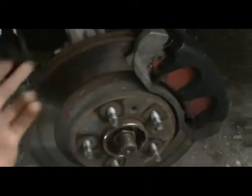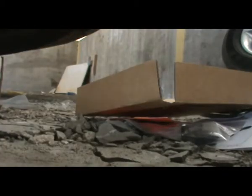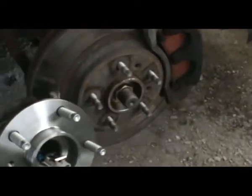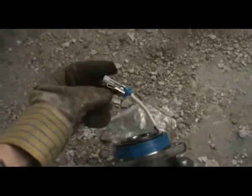Once we remove the disc, those studs where the wheel hooks up — that's the actual hub, the bearing. Here's how it looks. Behind the disc you'll see this thing, and that little cable is our ABS cable. This cable is going to hook up to this one, which goes all the way to the car's computer — and it's ripped. We're going to have to splice it and do it properly. You cannot just use duct tape. I know we're using the redneck method, but in this case, don't use duct tape. The new bearing is held with only three screws — once we remove the disc and open those three screws from the back, this thing will come off.